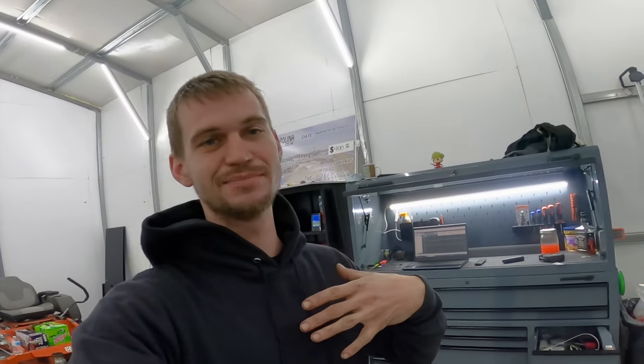I'm going to include a blooper on one of the runs, because I haven't mounted the ECU to the firewall yet. When I launched it on that second one with the outside view, the ECU kind of slid back and disconnected the connector a little bit, so the truck sputtered and shut down. It lost the signal on the cam sensor pin on the ECU when it pulled on the plug. So I'm gonna include that just for fun. Just a little mishap in the video recording process and me not spending time to go ahead and mount the ECU.